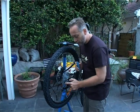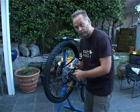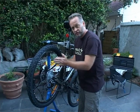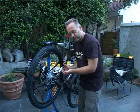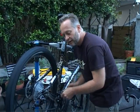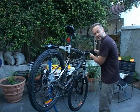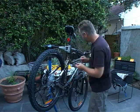As far as the shifting goes, it's controlled by cable tension. You can see there's a pinch bolt holding the cable, and the adjustment happens from the shifter at the handlebar — there's an adjuster there that makes the cable tension tighter or looser. For the gears to shift up, the cable gets pulled; to shift down, the cable gets released. If the gears don't want to shift to the next gear up, the cable needs more tension — tighten this way. If it doesn't want to shift down nicely, cable tension needs to slacken — turn it the opposite way.